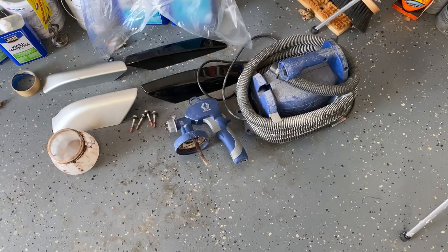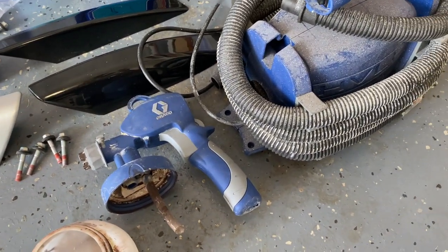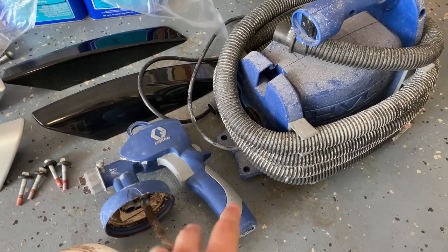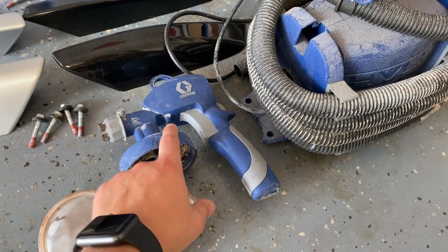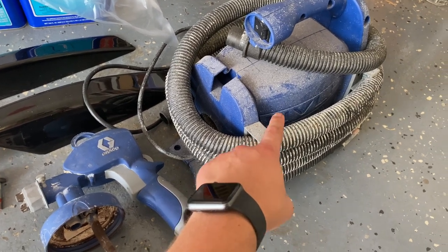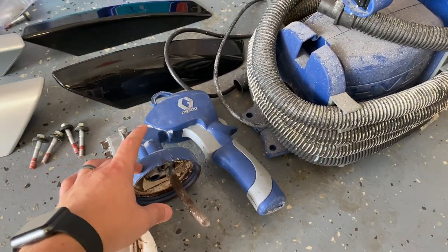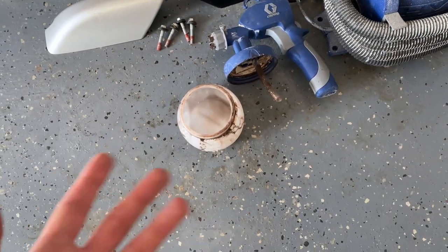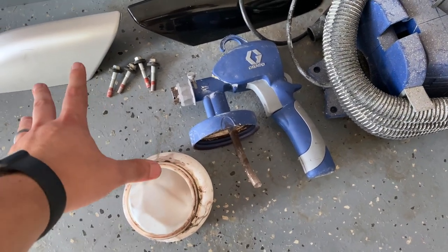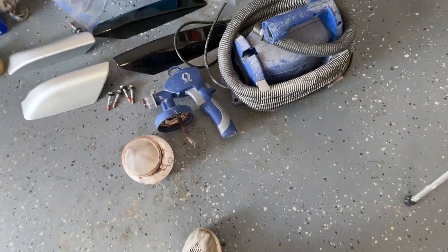So this is the sprayer I'm using. It has obviously seen some good use in its life. I'll link this down in the description, but what's important to know about this, whether you get this exact one or one like it, is that this does not have the motor or the turbine attached to the handle. This is a satellite turbine. So basically this generates all your air. This is all of your motor and everything like that. The air comes through this hose and then sprays through here. The reason that's important is because of all the different solvents in this, you don't want anything creating small sparks near atomized flammable liquid. So keep these things separate. You'll be in a lot better situation.